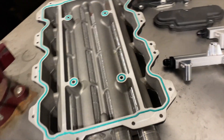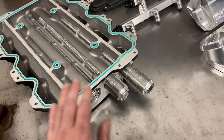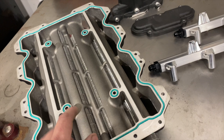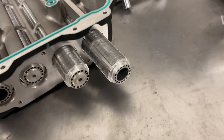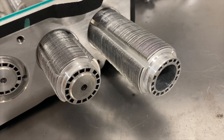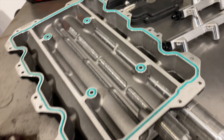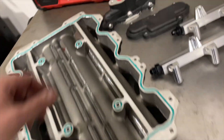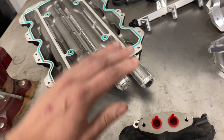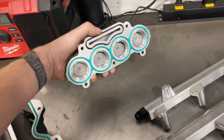The lid features an air-to-water style core — these are laminar tubes, there are four of them in the lid. The air blows up through these cores, which have very fine fins. The air passes through and the water takes some of the heat out. This is a dual-pass configuration — coolant enters, passes through the lid, and recirculates as the back half is capped.